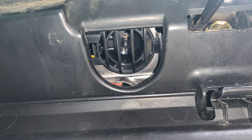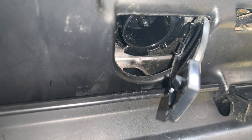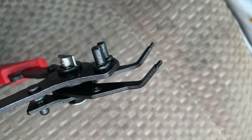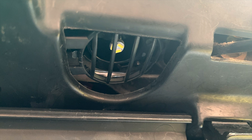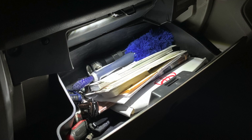After a while I realized it did have the glove box light. Here's a picture of what it looks like. What you want to do is get a little flat head and pull on the tab to bring down the cover. Once you've done that you can go ahead and get the bulb out — it's in a really tough location. This is the tool I used to extract the bulb and put in the new LED. Be careful not to squeeze it too hard and break it, otherwise you'd have to remove a bunch of pieces from your dash to extract and replace the bulb. Here you can see what it looks like after putting in the LED — it's a lot brighter and made a big difference when trying to find something in my glove box.